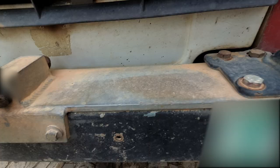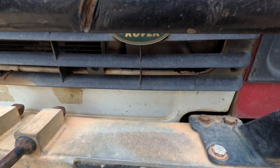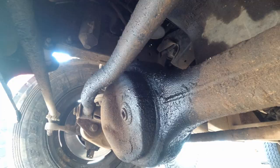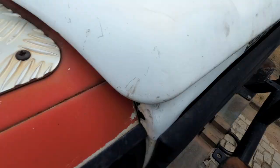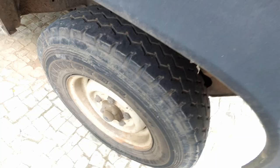This had aircon because it's been removed on the front. It's still got the blower and the evaporator inside. It's still got the dryer module down on the chassis right here. The front panel's been replaced and the condenser's been removed. Intercooler fins are pretty decent and the radiator - the radiator has popped out there. Another indicator side repeater is missing. You can still see the chassis number - missing a bolt out here, not ideal. Missing the dust cap.